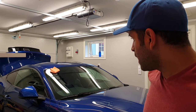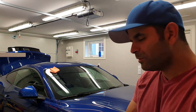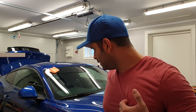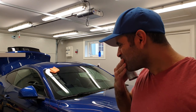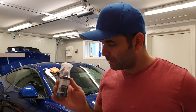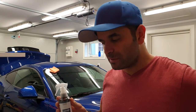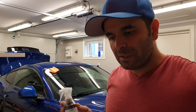I'll continue with the rest and finally finish this. With the coating, I have buffed all the excess off. I'm sweaty like hell — I don't know how many hours it has taken, it's taken too much time. Done all the plastics as well. And now it's time for the Reload. As I mentioned, this is to protect the coating until it has cured. I'll put this on, buff any excess off, and then let the car sit here for at least 12 hours before I bring it out.